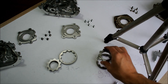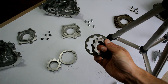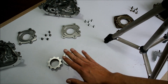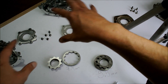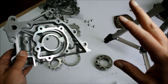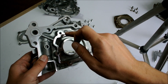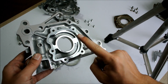Now here's the question: you want this design, but how do you know the oil pump you're buying actually has these teeth inside? Because not all of them have these teeth. I just bought this one brand new and it actually had the thinner gears, which aren't bad but aren't as good as the thicker ones. Finding out which gears are inside just by looking at the outside of the oil pump is actually almost impossible, and you will be counting on your luck. But there are actually some tiny little hints which, while not a rule, can help you increase your chances of getting the right oil pump gear design.